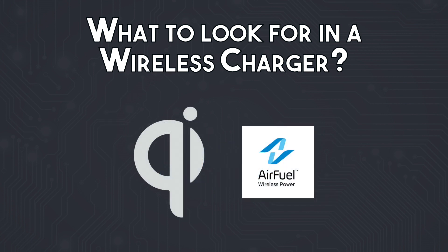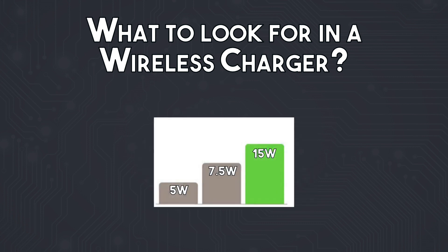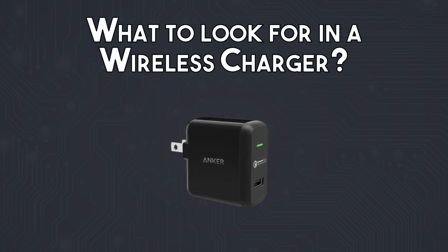Check to see what wireless charging standard your current device supports — it will probably be either Qi charging or AirFuel. Next, look at how many watts your device can charge at. Most chargers you will see are either 5 watts or 7.5 watts. Most current devices that support fast charging will charge up to 7.5 watts, but the latest Qi 1.2 standard goes up to 15 watts for compatible devices. I would recommend getting a charger that outputs at least 7.5 watts, or 15 watts if you want to be more future-proof. Check whether the charging pad includes a wall adapter; if not, you will want to get one of the same wattage that has support for fast charging and outputs at 2 amps.